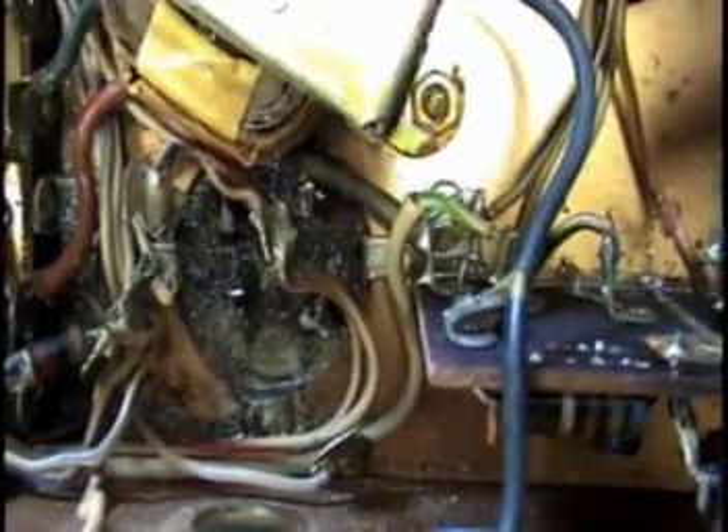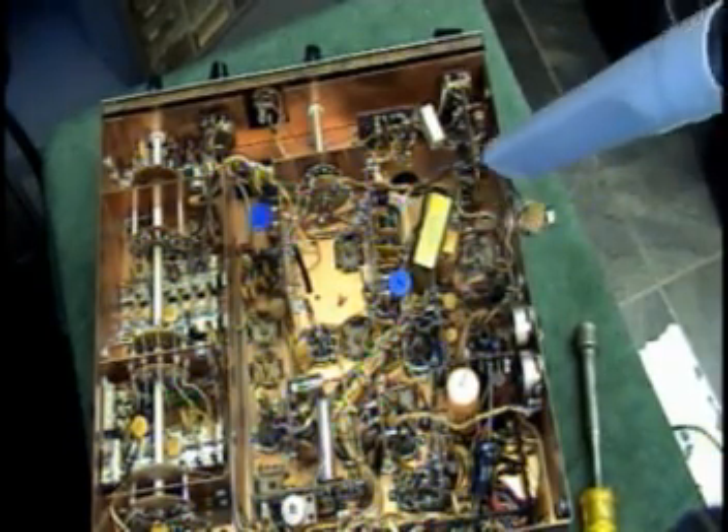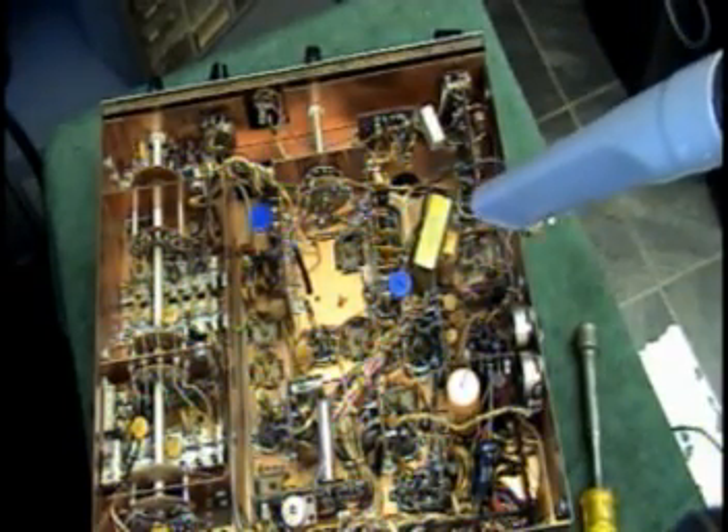So I've got the tab ground off, and as you can see with a pull, the cap's moving now — it's loose from that front solder point. Now before I flip it, I'm going to take a vacuum and get the metal shavings out of here so we don't contaminate other components.